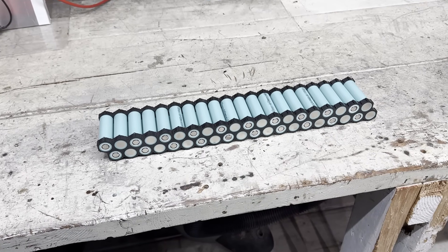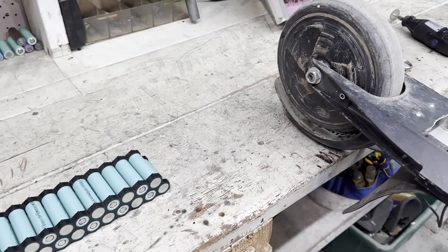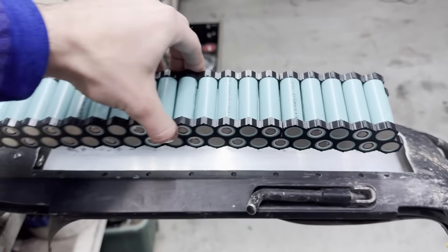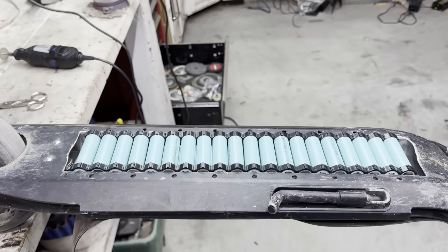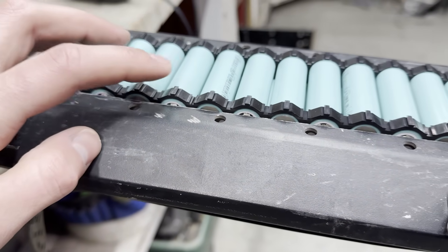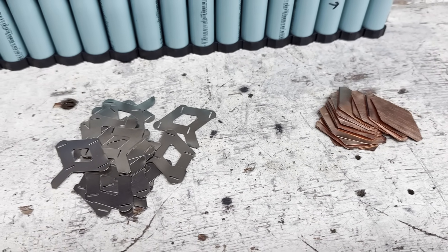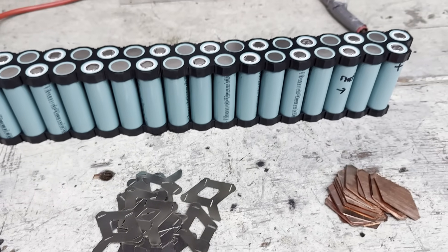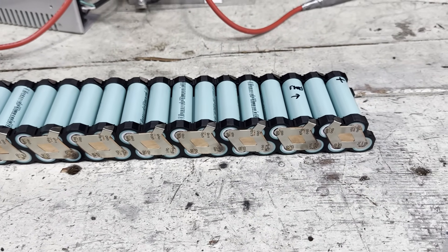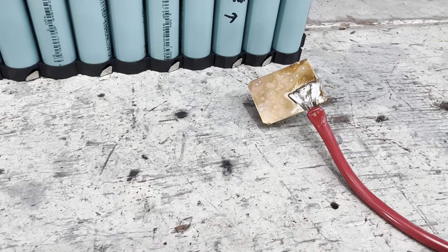Here's the layout of the new battery. Since it's only 4 amp hours, you shouldn't be able to ride for very long, but that doesn't really matter because the motor will overheat after a while anyway. Here's how it fits in the frame — nice and flush. However, it could fit even better if I grind off these little pieces here. To start building the battery, I cut out some 0.1mm copper and some 0.15mm pre-cut nickel to spot weld on. For the main positive and negative, I soldered some wire to some copper and spot welded it on.